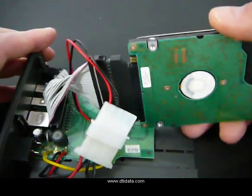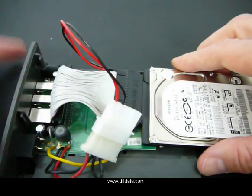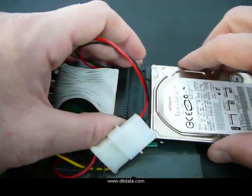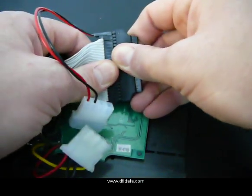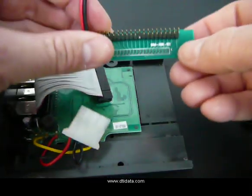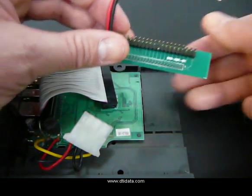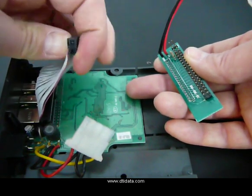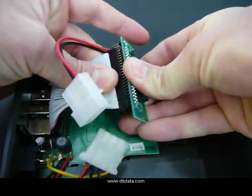This shows that it's lined up correctly. And you just plug in your USB cable, power on your drive. Showing the other adapter. This adapter here is clearly marked with a 1. You want to line that up on the IDE cable inside the tray, which is marked clearly by red. Press it in firm position, have that lined up.